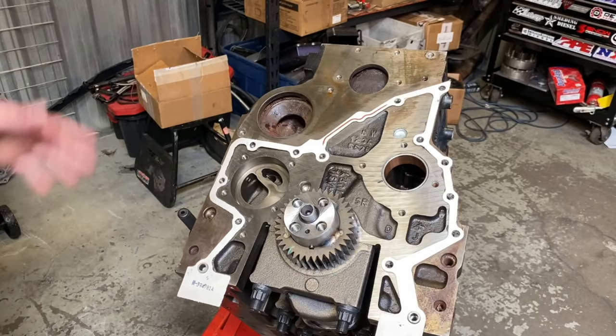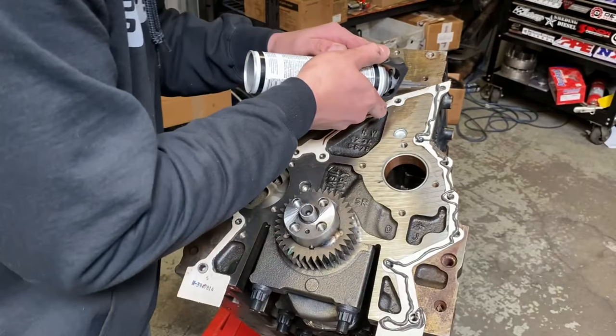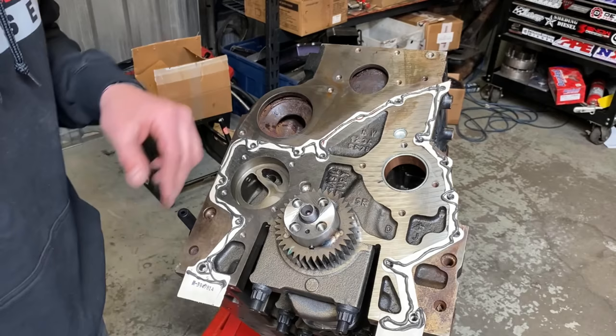And then I will do another round of silicone. Again, you guys don't have to do it this way. This is just how I do it. You want enough silicone where it breaks away easy. That was actually one thing I learned at Drew's shop that Gene showed me, is instead of using a minimal amount of silicone, use a little bit more. It gives you an easier way to grab onto it and break off the extra once it's set up. So that's something I've kind of taken with me from their shop.